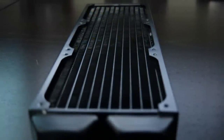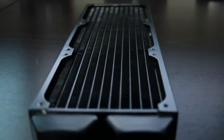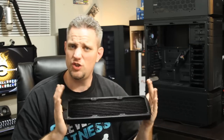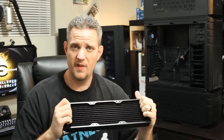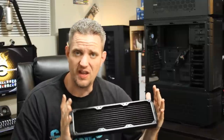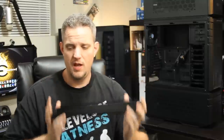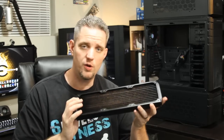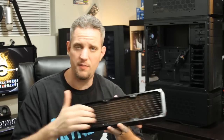These little zig-zag pieces of metal here are increasing the amount of metal that's absorbing the temperature. You have a lot of different FPIs — fins per inch — like 7, 10, 16, 20, or 30. Rule of thumb: if you can't fit a lot of radiator space in your computer — say you can only fit a triple — and you want to cool a graphics card and a CPU, you're going to want a higher FPI, because you can increase the surface area and overall cooling capacity of the radiator by manipulating the core.